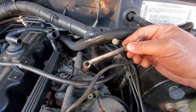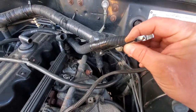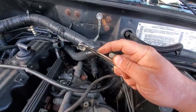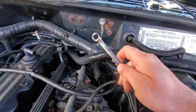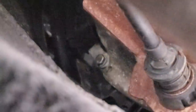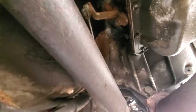I've been in here for about 10 minutes and it is extremely hard to negotiate a tool in here. I found out that this 11-millimeter box wrench is the best way to get at it, but this bend is just not quite steep enough. So I think I'm going to have to sacrifice this 11-millimeter. I'm going to heat it up with the torch on the vise, give it a good bend, and that should help me get to it. If you're wondering why not just try to get to it from underneath - well, let's take a look. You have to get around all the linkage junk for the transfer case and we've got the drive shaft in the way. It's definitely a challenge from the bottom as well as the top.